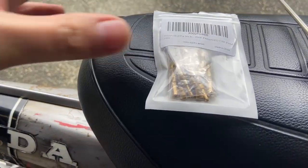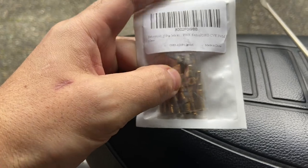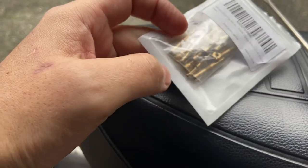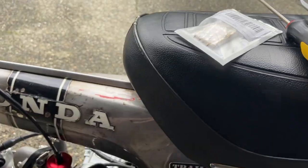It's a couple days later. I ordered a jet kit — just some random jet kit on Amazon that seemed to have good ratings. Got the jet kit today so we can put in some lower numbered main jets. I think that's going to be the ticket, so we'll see how it goes.